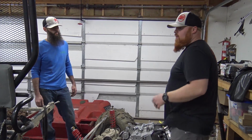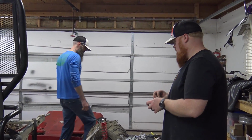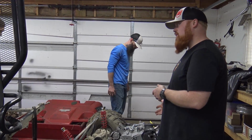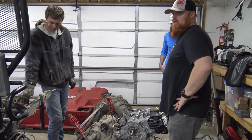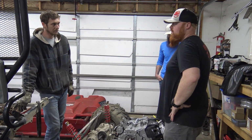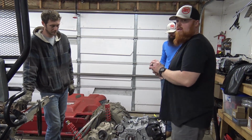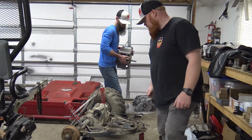You know, we can do something like a 440 Duramax on it and fit it on there just fine, but it would also be sweet to have a 625cc single cylinder. Now at Duramax we could put some 18-pound or 50-pound valve springs in it and a billet rod, and leave the standard flywheel and put a torque cam in it and really make some power. And I got a ported head for a Duramax as well.